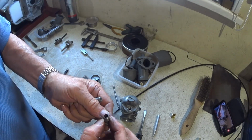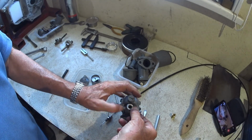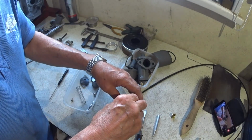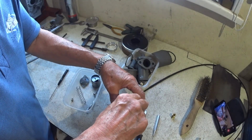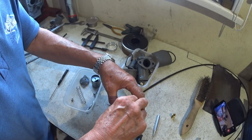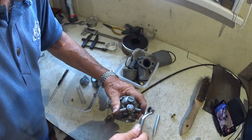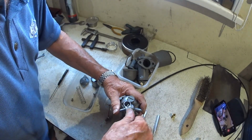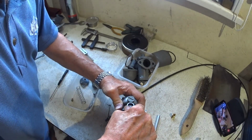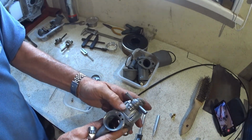It looks like a nylon seal, that one. And then this, the wings on this one face backwards towards the air filter. And in we go. So same with the spanner on that as well. So just get it square. And don't go mad. Obviously you don't want it to come undone, but don't forget you're just pulling down on this soft material which easily deforms.